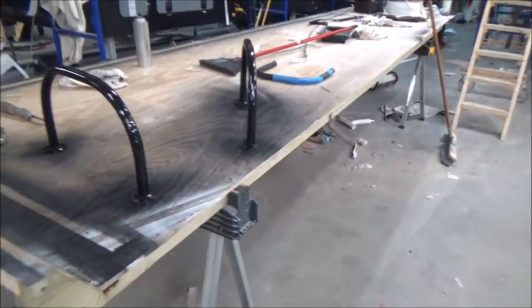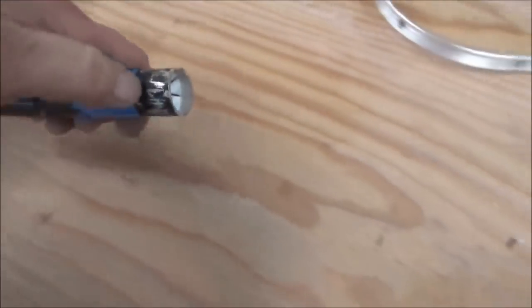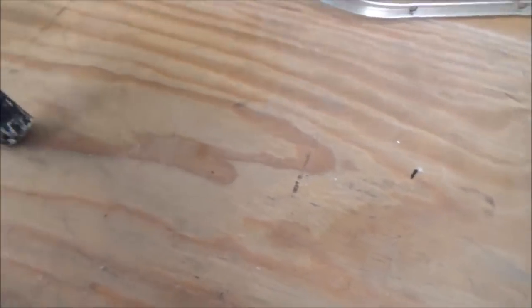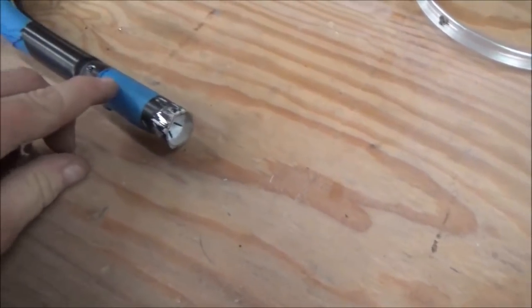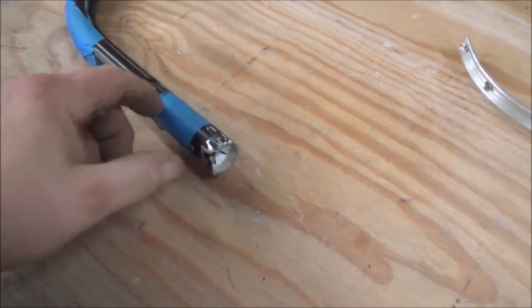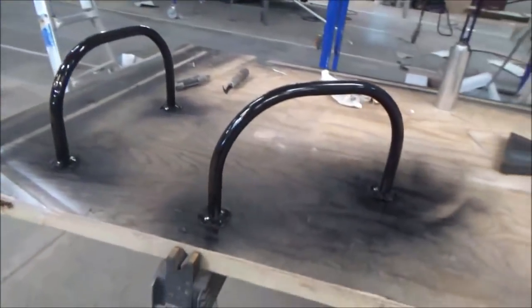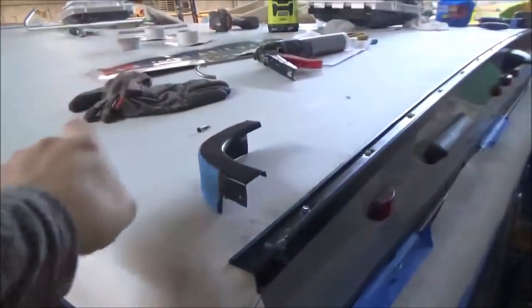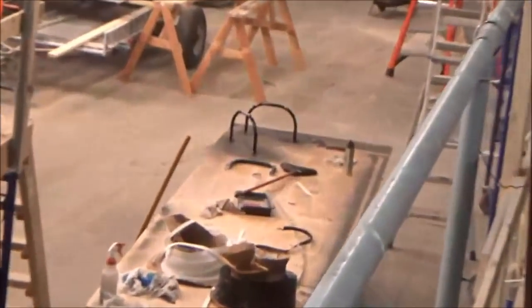I wanted to show you this - this is the ladder rung that came off. It goes way on the top where that ladder is, sits on the roof like grab handles. This is just some cheap aluminum - evidently he hit something with it and bent it all up, got crookified. The other one's bent up worse than this, so we fabricated some new ones and painted them. Those are actually real steel - a lot stronger than what he had. The way they originally put the screws in, those tiny nuts don't have enough holding power - that's why it always wobbles. I use a longer bolt and ours are all galvanized.